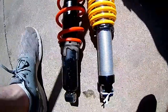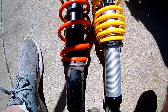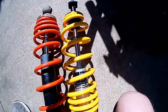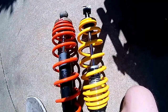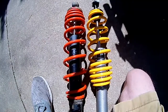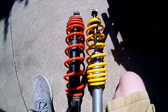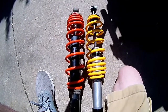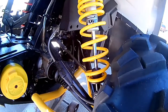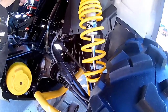It's fine-tuning — the XMR has steps, whereas with the Fox you can go a millimeter at a time. The big thing though is the suspension travel and spring rate. They're not gonna bottom out. If he bottoms them out, he's hitting it really hard. Should be a lot better than the factory ones.